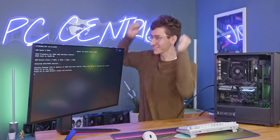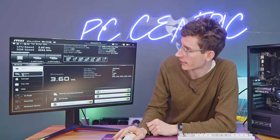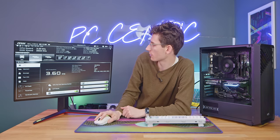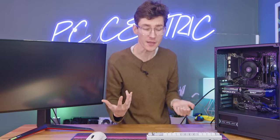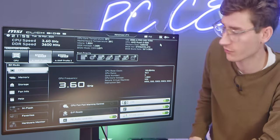It's basically loaded us straight into the BIOS. The only thing we really need to do is go over where it says XMP profile, hit this button, and it's going to change our RAM speed from the slower 2666MHz to the full rated speed of your kit — 3600MHz. It will then restart, and assuming it supports memory overclocking, it will restart and we'll be ready to install Windows. You can verify this by checking that the DDR is now set to 3600MHz.